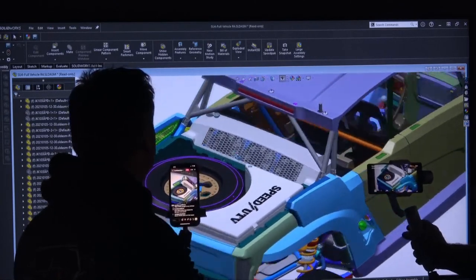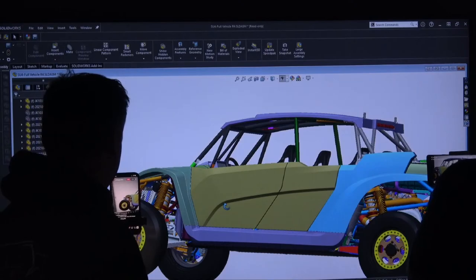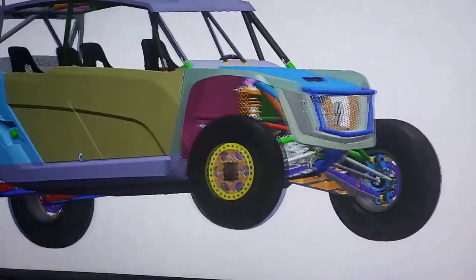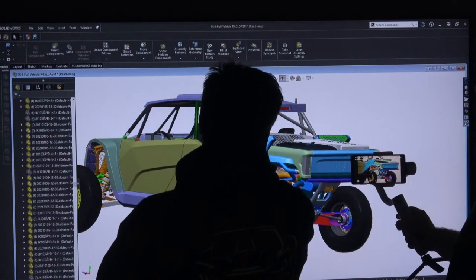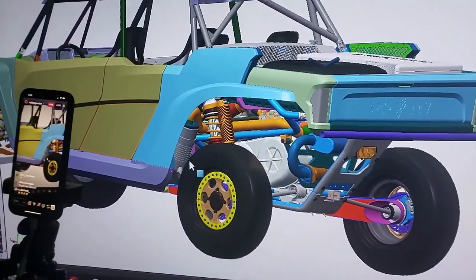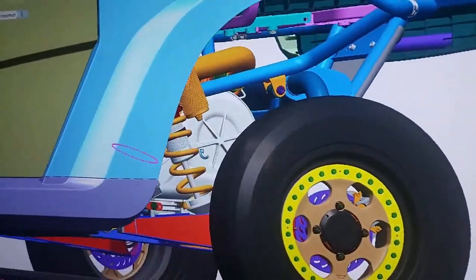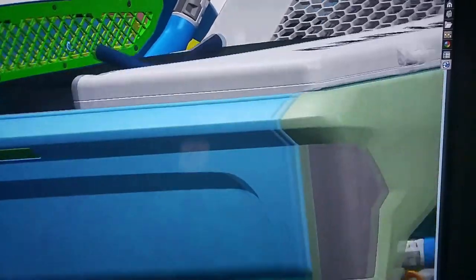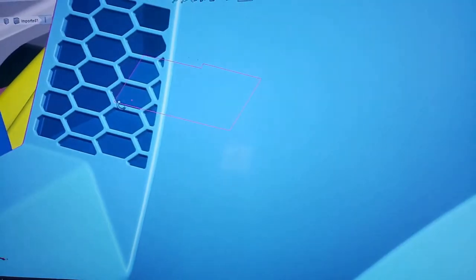Crescent box mounted on the side there. It's amazing when you look at the car detail from that first video we started showing tonight and where we're at today and how far it's come. Someone asked about the air filter. Air filter is here in front of the rear tire. The air filter comes down off the bottom and it's mounted like a tractor where the clean air is sucked through the top. It comes from about mouth high for water intake as you're sitting in the vehicle. And there's a front vent right there to ram a little bit more air in. That is air filter and CVT inlet.